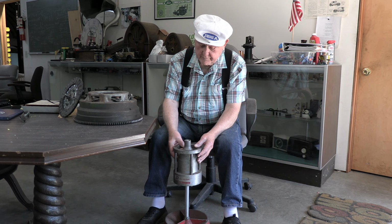The difference between settings: at a 1/2 inch setting, the pressure on your clutch lever will be 35 pounds of pressure to put your clutch to the floor. If you set it at 5/8 of an inch, you can be at almost 40 pounds of pressure. And if you set it at 3/4, it's more than 40 pounds pressure on the pedals. So the most efficient place to set it is so that these are 1/2 inch. And I do have concurrence from Les Andrews that that's okay.